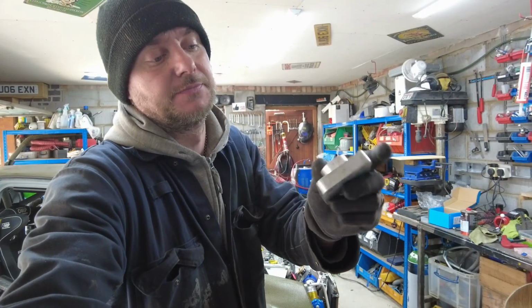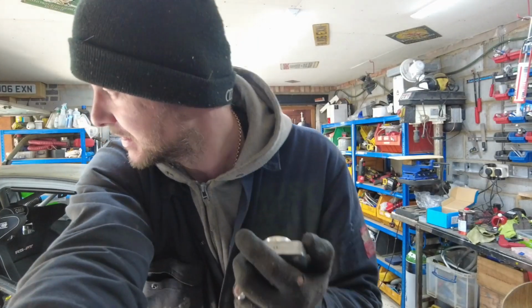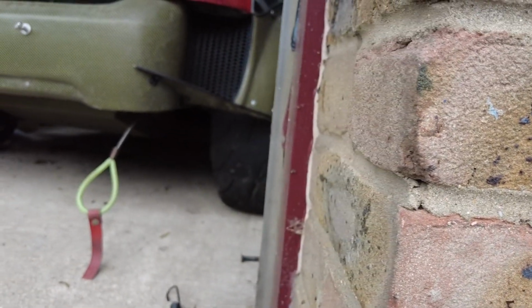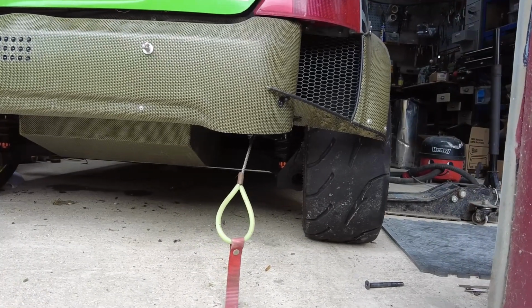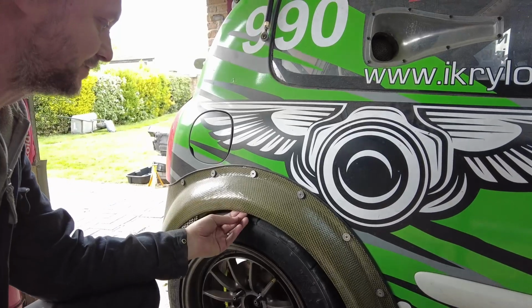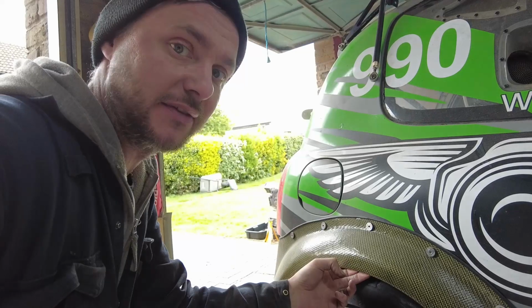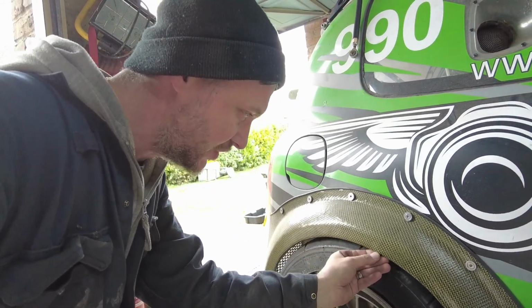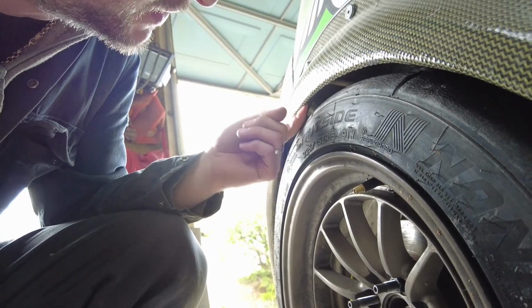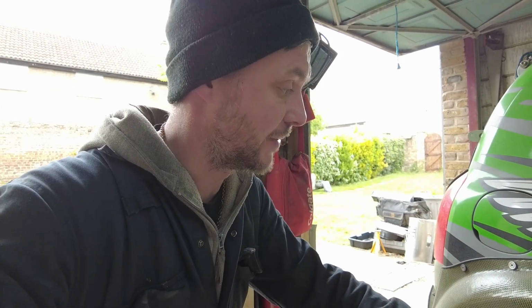40mm to exactly 15mm. Let's fit this and see if it actually improved the stance. Oh yes, the calculations were kind of correct. 25mm in, and we have just about enough clearance, I reckon, with camber, and obviously the rear never actually went down this much. I might trim this slightly bending inwards lip on the arch, you see, just slightly like that, so even if it compresses, it doesn't touch. But I reckon I'll be able to tell on Saturday if it starts touching. I'll get the tool out and just trim it right there. I'm not going to bother now because there is not enough time. On to the other side.